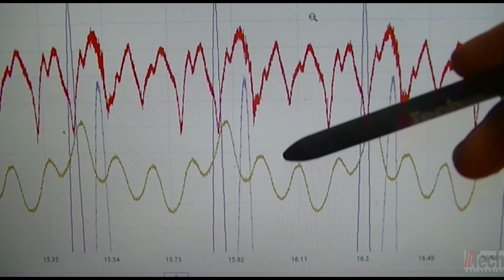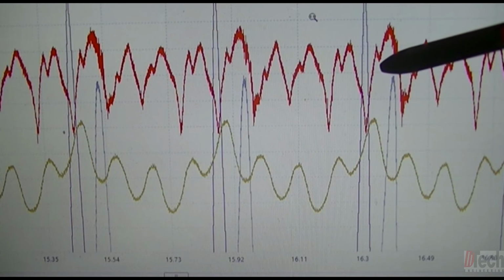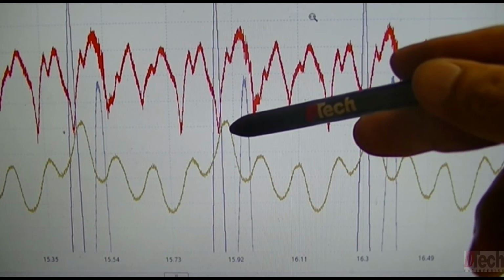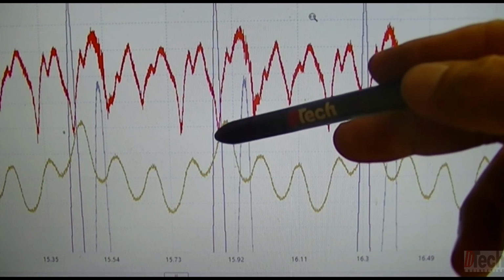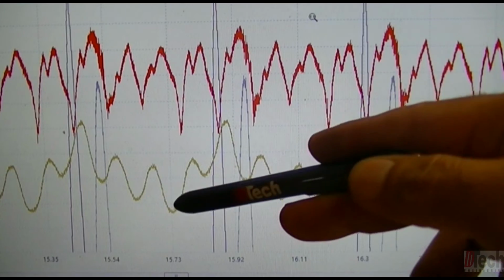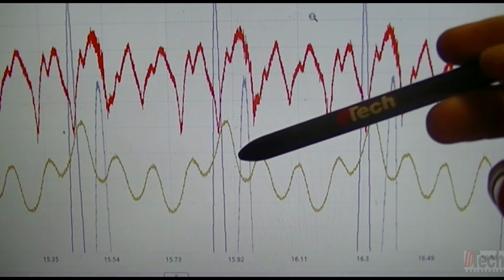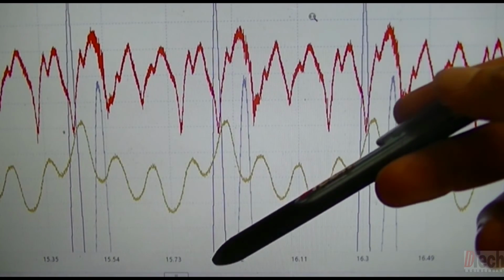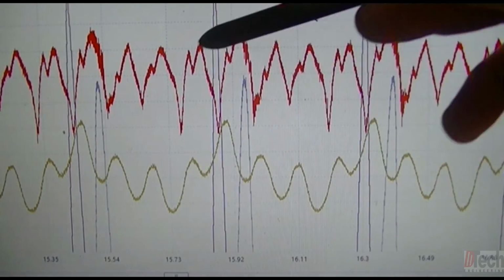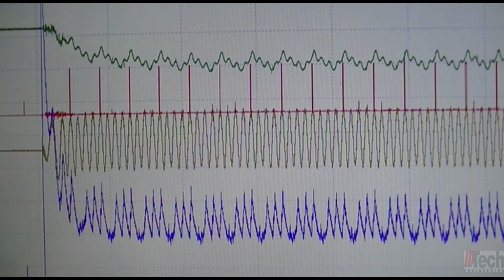So then there are two patterns that you can look at and hopefully try to make some sense of, but it takes a lot of time to not make the wrong call for the intake trace. You have to, again, gather a lot of other information. I mean, it's a good guide. It's a starting point. It lets you see there are mechanical problems. But to get an accurate answer or diagnosis, you have to do further testing and make sense of all the other scope captures that you gather. So all of these tied together just help answer what's going on with all the waveforms that you gather. So that's pretty much it. Not much more crazy to explain.